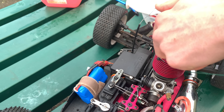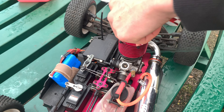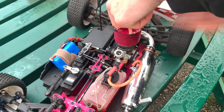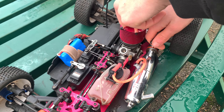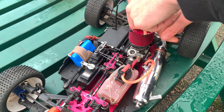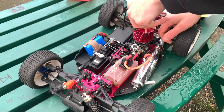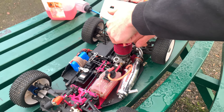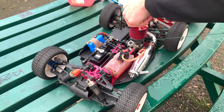Throttle neutral. See, it's a little bit wet in there — that's how you know fuel's getting through. What you've got to do is chuck this in and pull it. Obviously if it doesn't start, you know you're not making fuel, air, or spark — you don't know which one; you've got to find out. It doesn't help that they're cold as well.